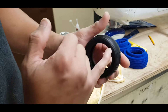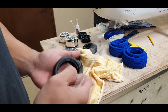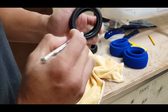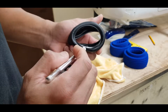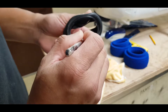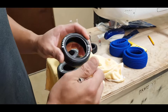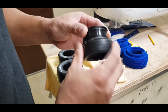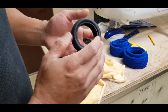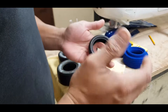Now the reason for the razor blade: if you look inside the tire, in the lip, do a little inspection and you will see some rubber burrs — like flashing. You want to get rid of this flashing. Just use a brand new razor blade and go around and cut all that flashing off. The reason is you don't want that flashing to fold over in the groove of the rim.